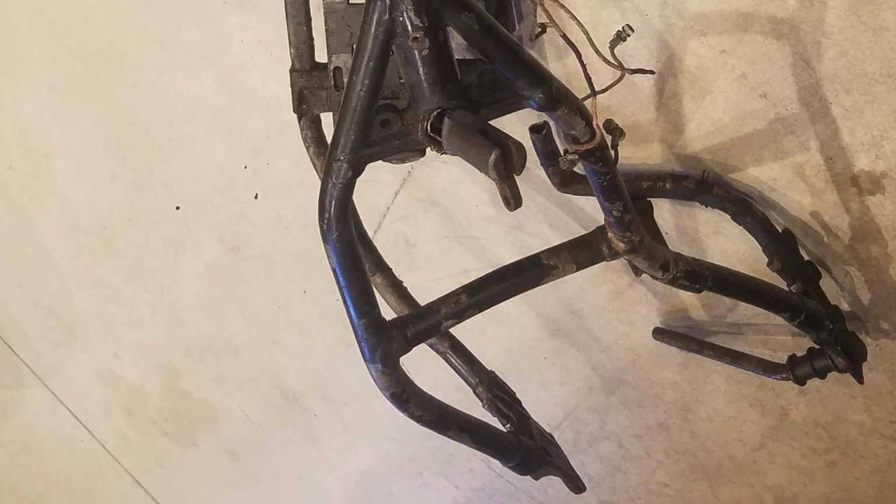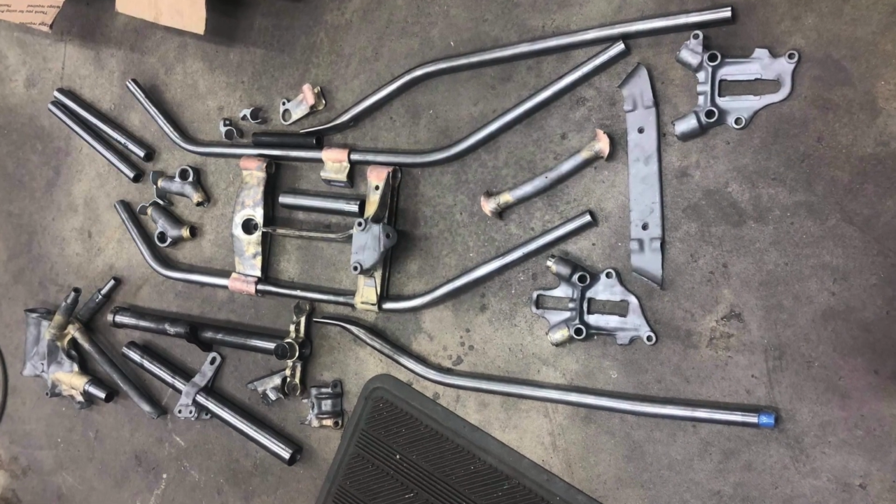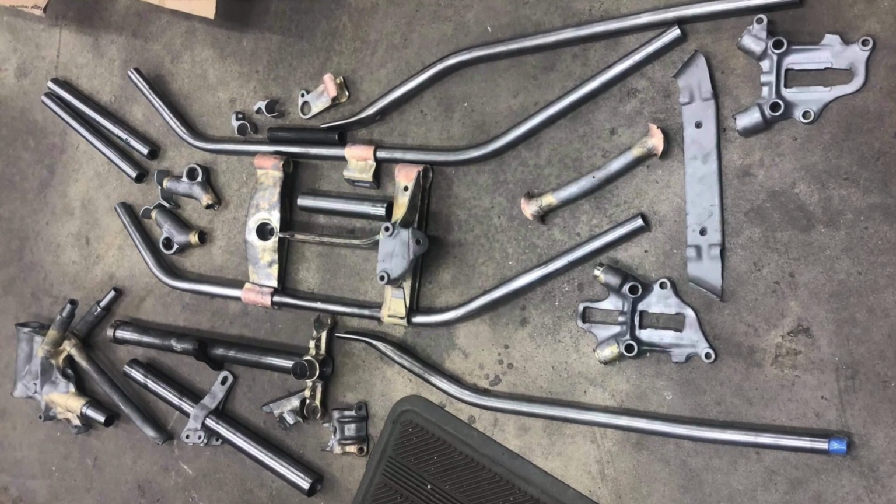Even though I had a better frame, it would be fun to bring this relic back from the dead and ride the heck out of it. I had to take every tube out of every forging and straighten the harvested forgings out, fixture it up, and fit new tubes. I got the new tubes from my friend Jason Sheets out east. Everything went well on the frame project.